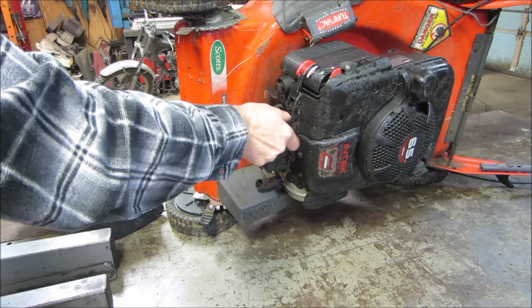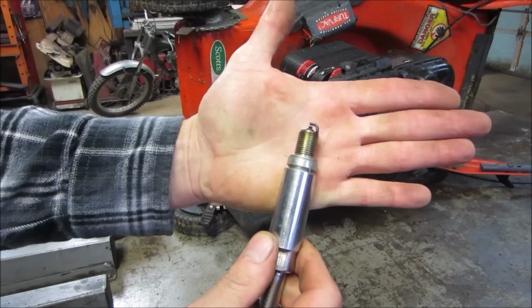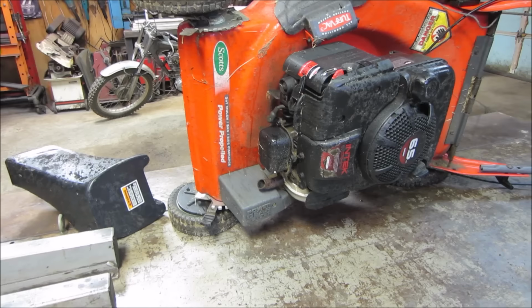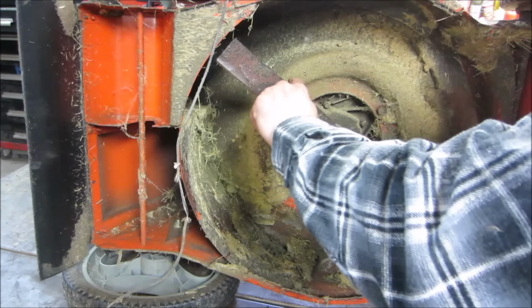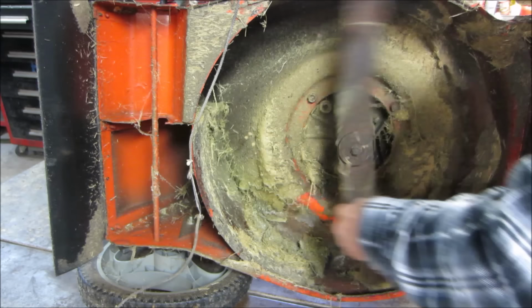because it's pretty oil fouled. Yeah. Wonder if somebody either ran it with a bad air cleaner. Seems like it's running rich. Might be over full of oil. Let's just make sure we don't have an issue here. I hear a little clunking, but we're gonna move forward.